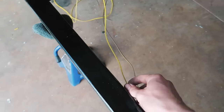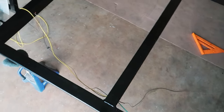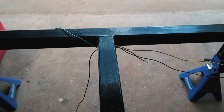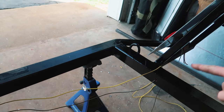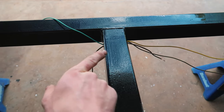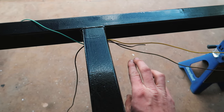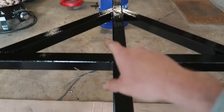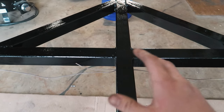Yellow is going to be left turn and brake. Green is right turn and brake, and brown is running lights for the rear. You only have two brown running light wires, so one wire runs all the way back — I got it coming out this way — and my excess I just snipped off since it's plenty long. That's going to connect to the wire that runs there, so it'll be a Y intersection: one wire comes in and two split off, one powering each light. I've done the same thing on the other side — another brown running light wire will come to here, I'll make a join to three wires, it'll branch off and split, and that's how I'm powering all the lights.